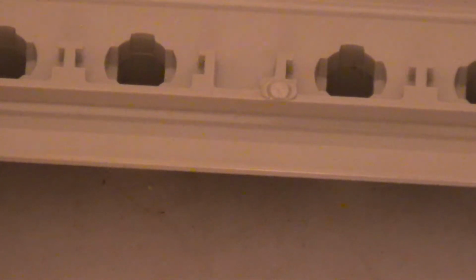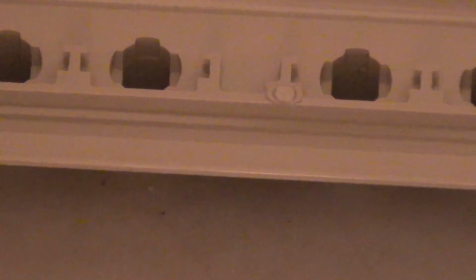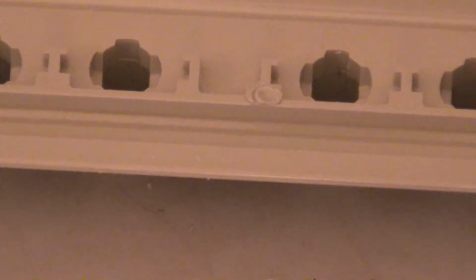Cut it off. Verify position. Dremel on. And let's create another divot. And don't forget to account for the curvature of the barrel plate while you're doing this. That's all you need to do. Just create a concave divot that the drill bit can easily seat into.